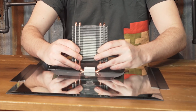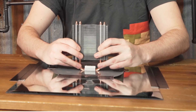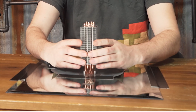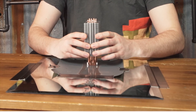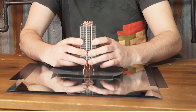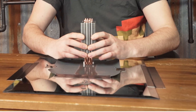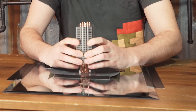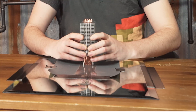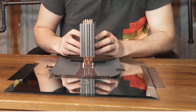Once you have completed one round of this, rotate the heatsink 90 degrees. Once you've completed 10 full rotations, it's time to move up a grit. It's an extremely tedious process. I would highly recommend putting on an audio book or watching a movie during the process — just make sure you don't lose count.